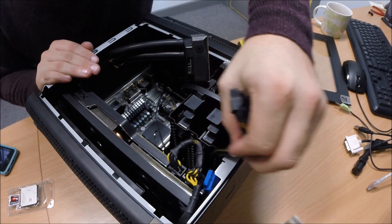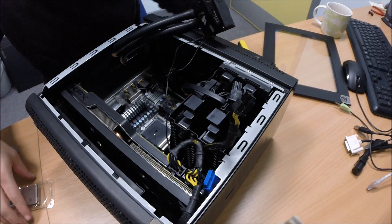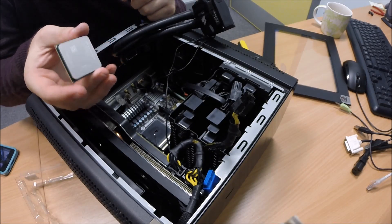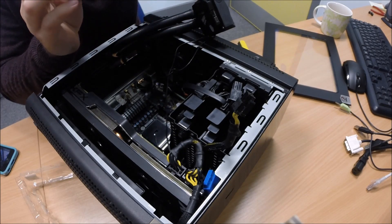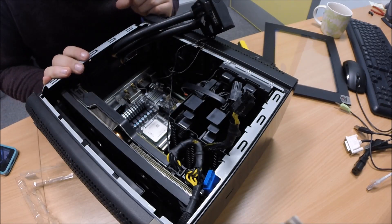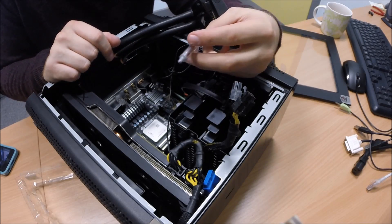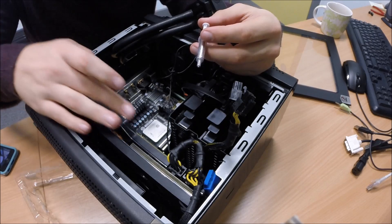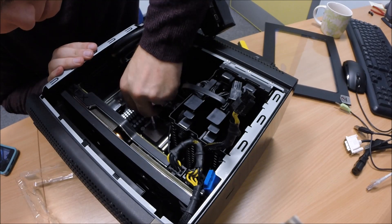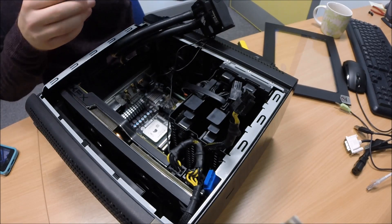Now I've cleaned the original processor so it can go back in its box, and the copper cooling block is cleaned off. Let's go ahead and put in the new processor. They weigh a ton, these processors — I've always wondered why they're so heavy, but I guess it's all the components in them. Look for your little key and put it in. Lock it down, nice and easy. Got some Arctic Silver here — it transfers the heat from the component itself to the cooling copper block. Without this you would have an ineffective cooling solution. Let's put a pea-sized amount on top of the processor. Then it's really simple: just put the block back on and screw it down, and that is a processor change.